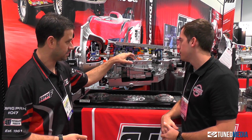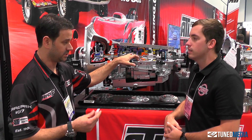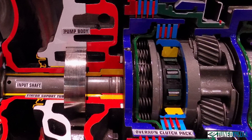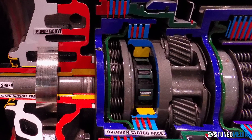This drum spins backwards at 80% of your engine RPM when you're in low gear, and when you shift to second it stops, and when you go to high gear it goes again. So it's really a critical functionality part that we have in cars that make over 3000 horsepower, so we know it's going to work here.